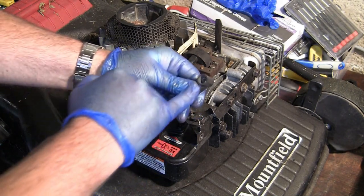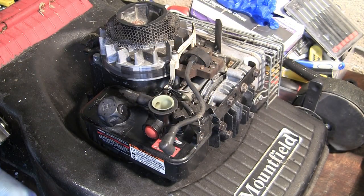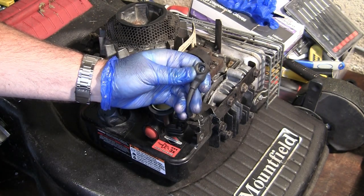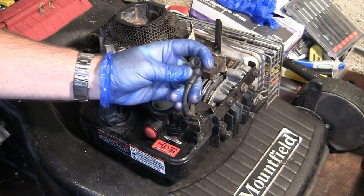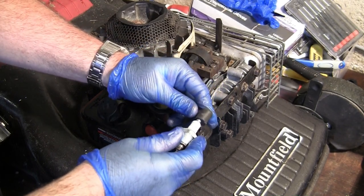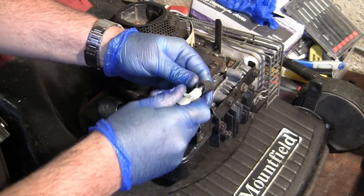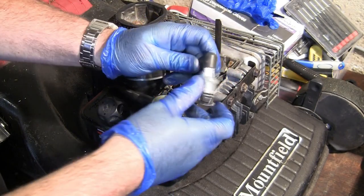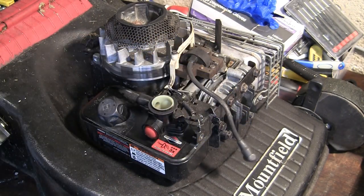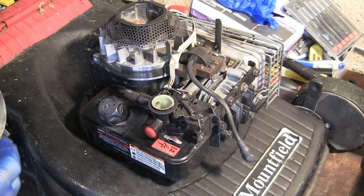Going back to the no-spark issue — I once picked up a lawnmower from Bradford that was about six weeks old. The only problem I eventually found was inside the spark plug cap. There's a metal contact inside that's supposed to click onto the spark plug and form a good connection, and somehow it had got bent so it didn't connect. It's a simple thing to check: push the lead onto the plug and make sure it clicks in so you can feel a definite connection. It's probably one in a thousand, but it could save you a couple of hundred pounds.